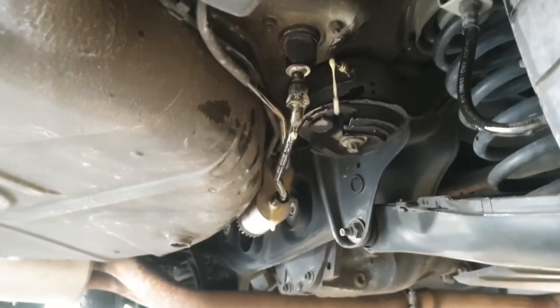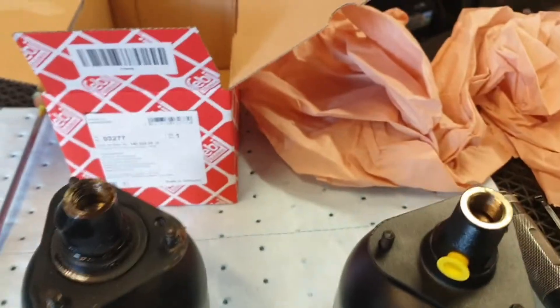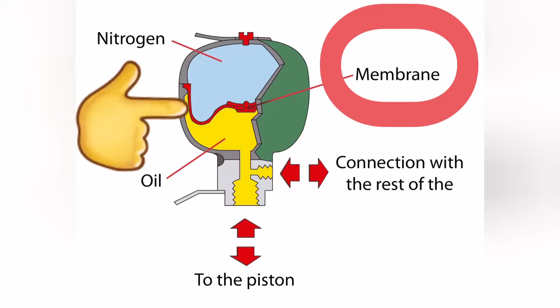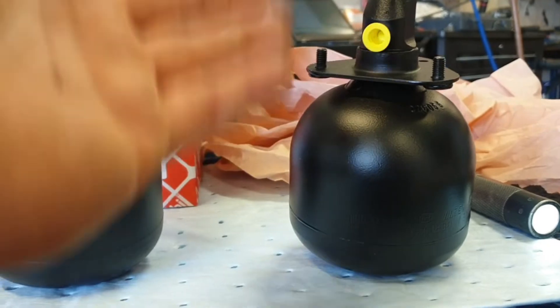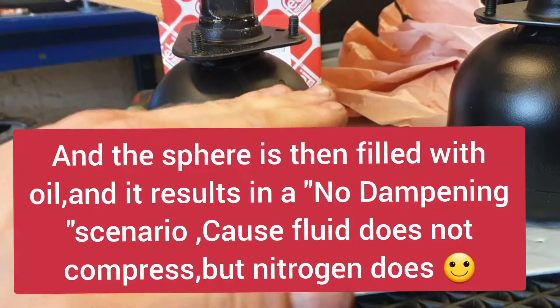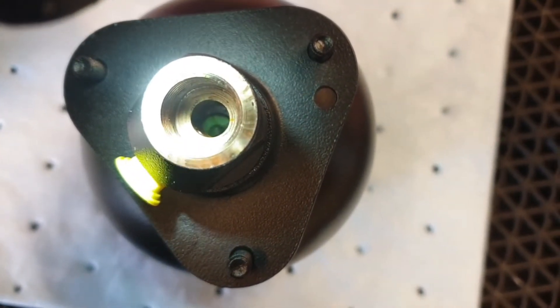I am really confident that this is the culprit for the bumpy ride. How you check these spheres or pressure accumulators is pretty easy — if you look through these you would see a diaphragm that is located up here. There's a metal part in the middle that I guess they use when they fill them with nitrogen. When these break, it blows the diaphragm through and you get a hole. There's no diaphragm up here anymore. You can see that green part — that is the center of the diaphragm.